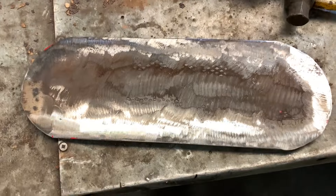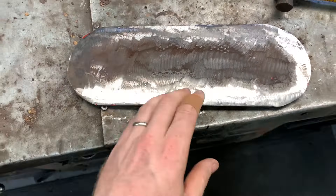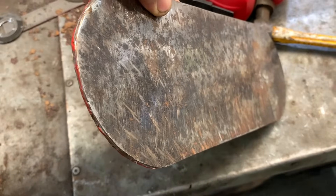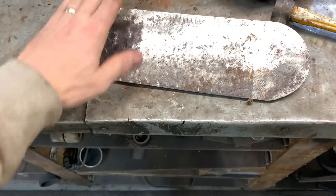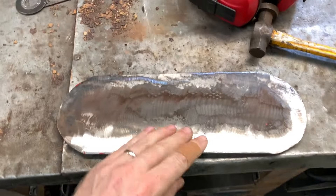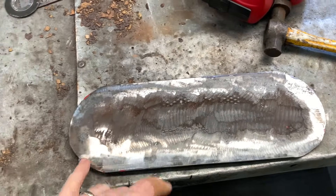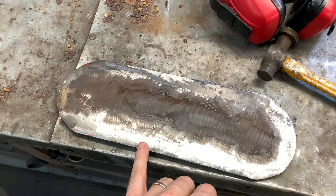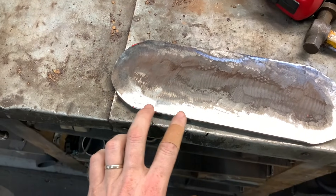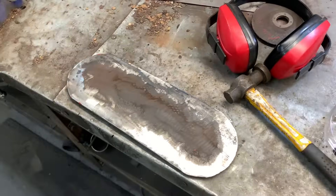Here's the piece all cut out and cleaned up. You can see the center — I left it alone because it's actually factory undercoat, so I'll just leave that and paint over it. Got it cleaned up around here for the welding. This side is kind of rough-looking because my grinder has a wobble to it — one edge constantly hits the metal and makes a mess. So I'll put that on the back and the nice flat side will be on the front. I think I'll stitch weld this — I don't really see the point in going the whole way around with the welder. I'll probably do an inch every inch or something like that.